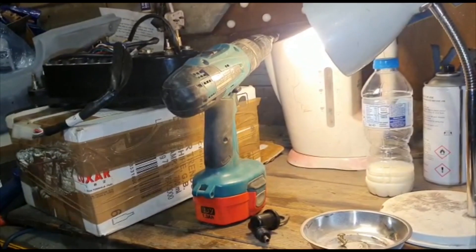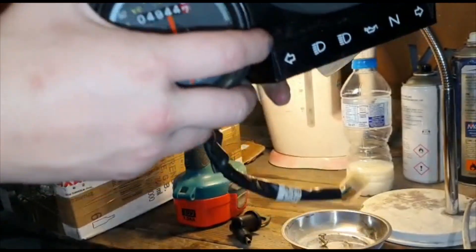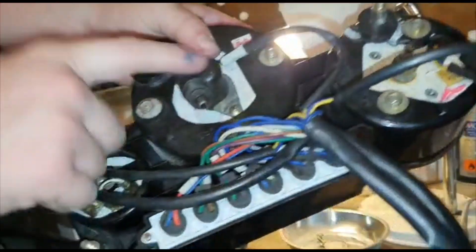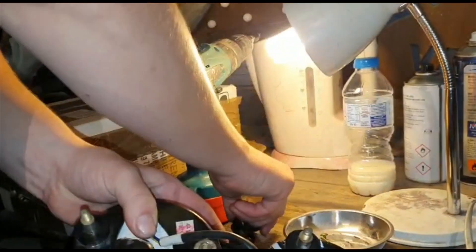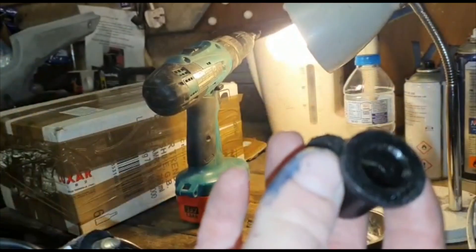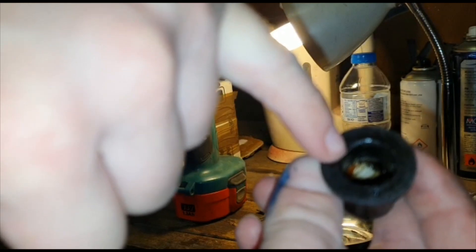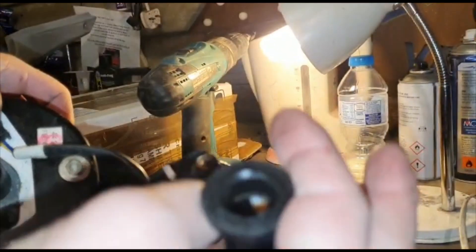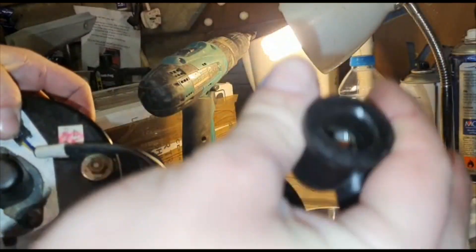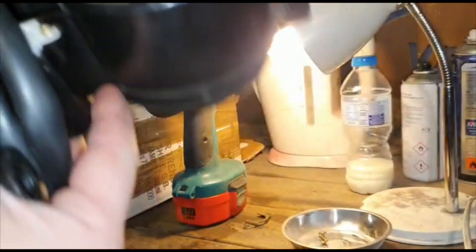So it appears I've figured out why my speedometer clocks weren't working. On here there should be a little plastic cog that goes into the little gear in here. This one happened to have one, but this one didn't. There should be a little bit of plastic just in there - the little white bit - and it sits here, spins and sits on the back of the actual clock in this little slot. So there should be a piece in there but this one's missing it, which may actually be the problem. Also just noticed there's damage on the back of this clock as well, which is a bit disappointing.